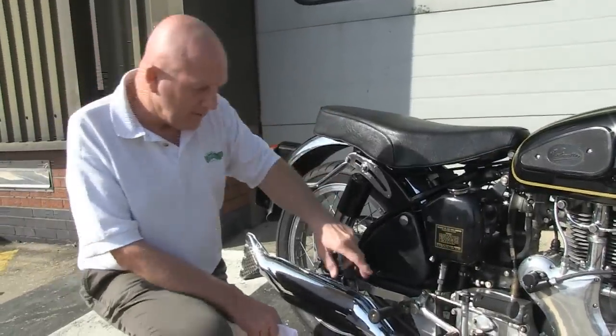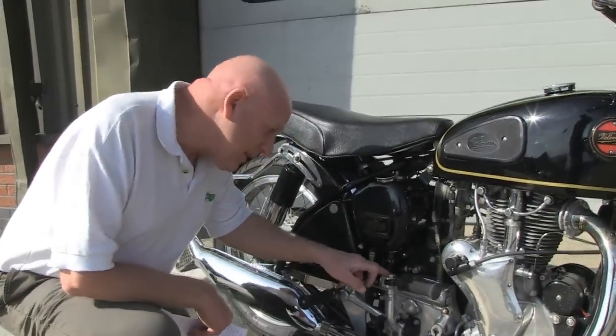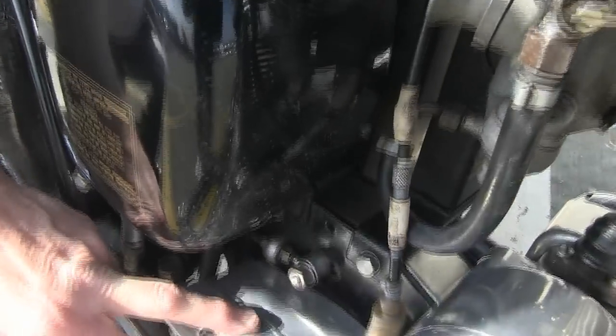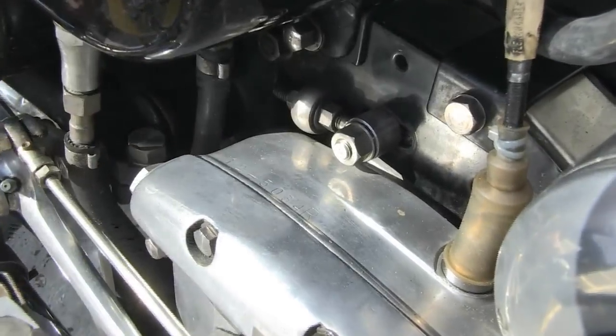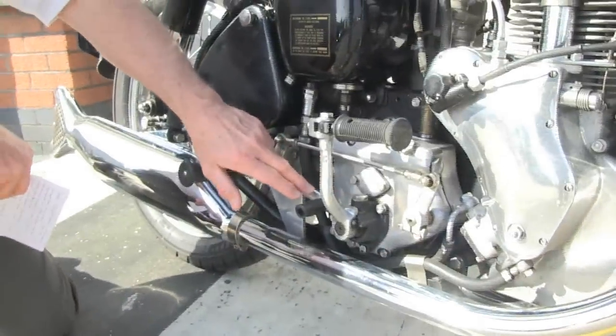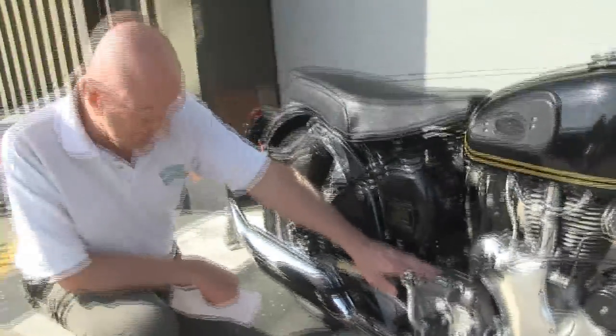Now, one thing I've forgotten, the gearbox here, it says on it 12-5034R. Well, that is what they call in Velocette circles a series 12R close ratio gearbox. And if you see all this here, it's got the reverse cam plate in it as well, as per the Goldie. Essentially, it's the Velocette equivalent of the RT Goldie racing gearbox.